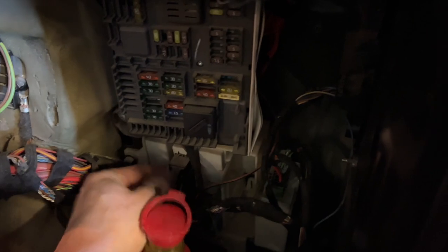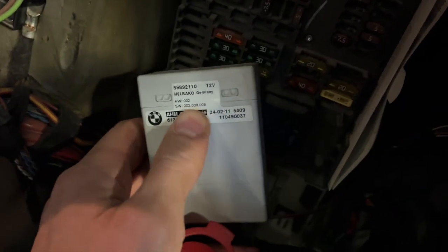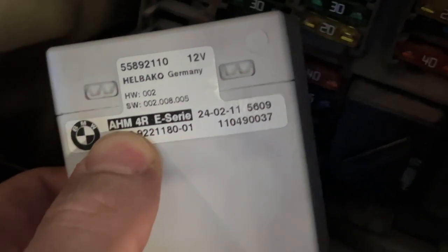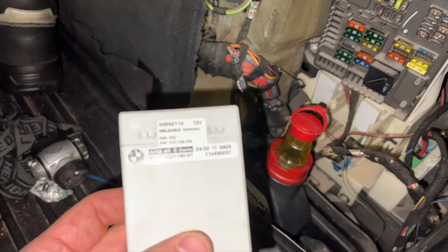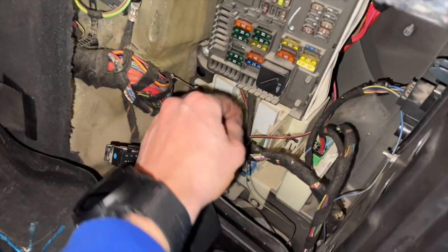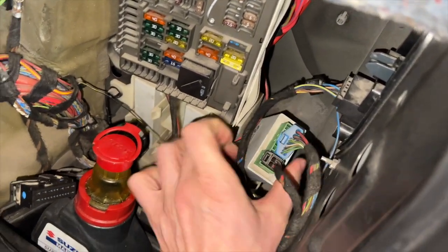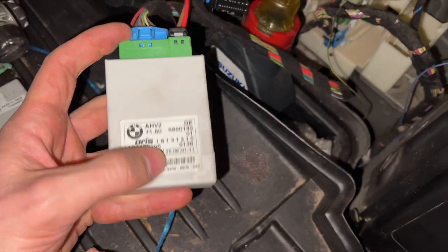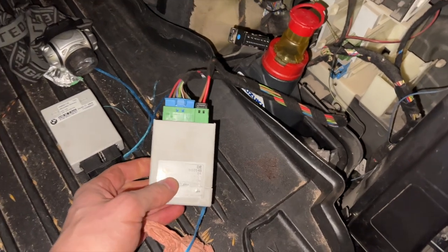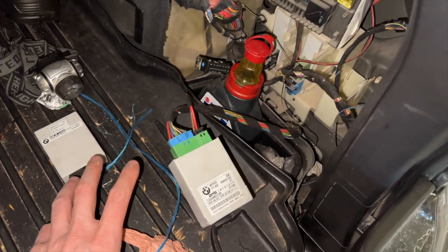We need that one. You just pull it off — and as you can see, the label reads AHM. AHM is the ECU for the trailer hitch. Just unplug that connector and you're done. I have removed that ECU. If that is not enough, there is also a second ECU labeled AHV2. Sometimes it's also required to disconnect that one. For the first attempt I will leave the AHV2 still connected and try coding with only the AHM removed. If we're unable to fix the error, that second ECU may also need to be removed.